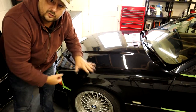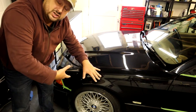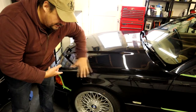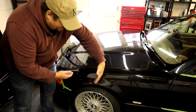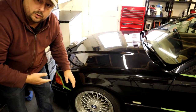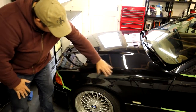DAs like being used flat. They're tools that you can't really tilt, because you'll stop the sideways movement, it just doesn't work. You'll stall it out. It's not designed for that. Whereas with a rotary, you can tilt, and then you can get a different profile of the pad and go down there. So it's an important little tip, that, actually. The smaller pad will cope with what I'm asking it to do on the wing a lot better.